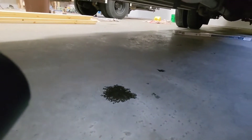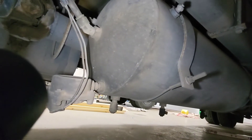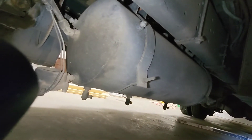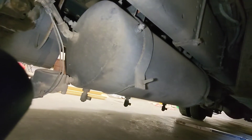You'll see the oil stain on the ground here. When I did open up these valves, I found oil in these tanks, which means the air compressor is starting to fail. That's one of the reasons to drain your tanks regularly. You don't have to drain them all the way down to zero — you just need to drain any moisture or fluid out of there. If you see oil coming through, you know you have a failing air compressor, and it's a good time to get that repaired before the thing dies altogether and leaves you stranded.